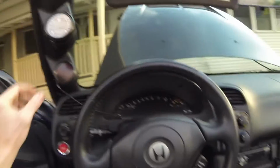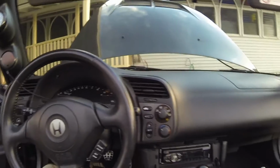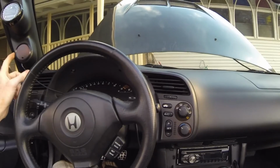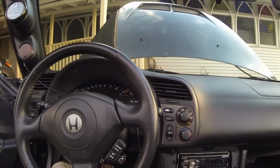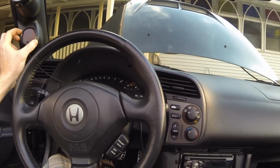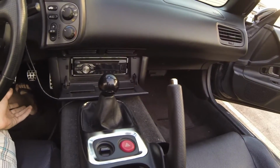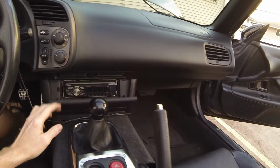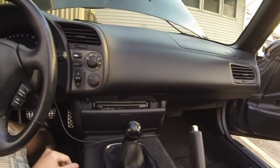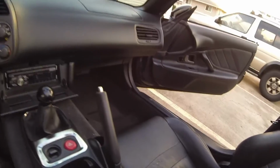And then I have all Haltech wideband gauge too. It's because Haltech makes really good stuff, and their wideband gauges are pretty close to top of the line, especially for the price. It delivers a really accurate wideband signal, about as good as you can get on the LSU 4.2 sensors. The LSU 4.9, that's a factory wideband that's in all the factory cars, is better, but there aren't many affordable wideband controllers that use that sensor. Just factory cars.